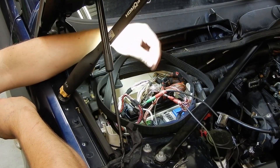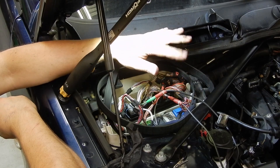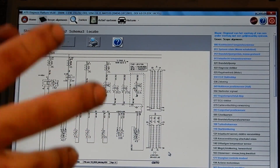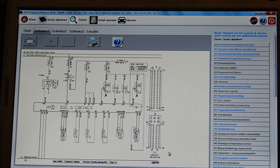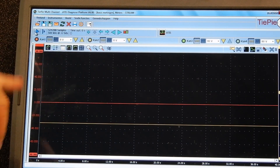I've got the cam sensor and the crank sensor back-probed here at the computer — it's easy to access there since the crank sensor is underneath the car and hard to reach. My scope comes with wiring diagrams, so that's what we're using. Got my two-channel set on the scope, one for crank and one for cam. Both sensors are Hall effect sensors, so we're expecting something around 5 volts. Got my channel set at 8 volts. Let's crank it over.